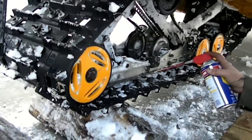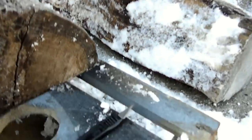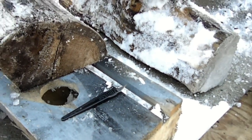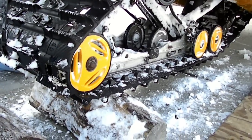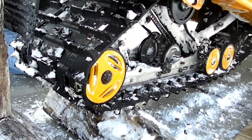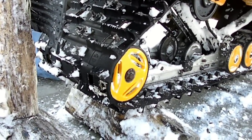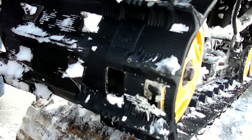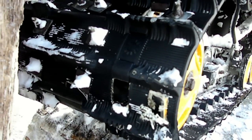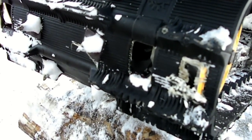We finally got the slider out and unfortunately ended up having to cut a little bit of the window — just a small piece — using an X-Acto knife, just to let it slide through a little bit easier. I really don't recommend this, but it was so cold out the track wasn't being flexible enough. If you do have to do it, take a little bit of flame and melt the webbing showing through that spot so it doesn't cause the hole to tear any bigger.